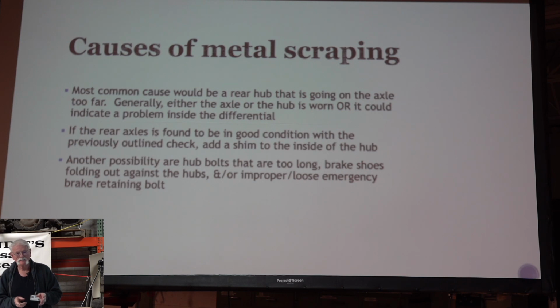But I bought some new axles a while back, brand new made rear axles, and they're an eighth inch longer than the originals were. And what they said was, if you put the Rocky Mountain brakes on, you're going to stick another drum on the back of the original small drum that spaces it out a little bit. So if they added an eighth of an inch to the axle, you're good to go on that, which I thought was kind of ingenious.